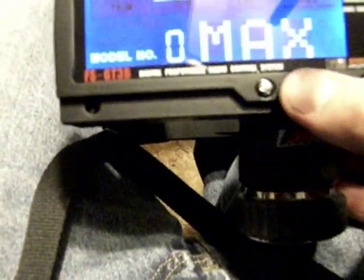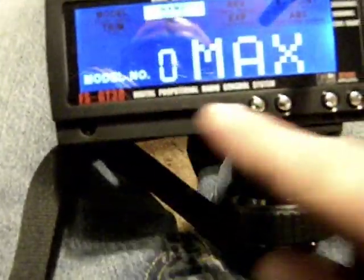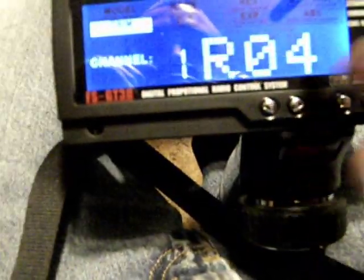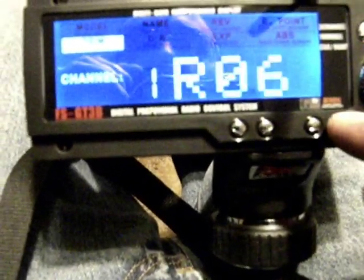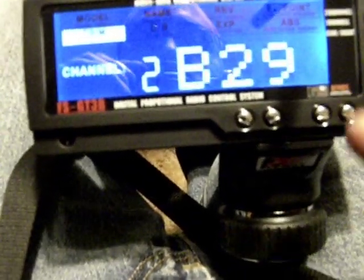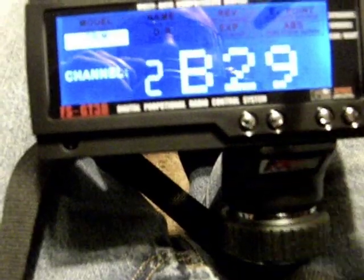Let's say you're driving around and you start messing with your steering trim. Without looking at any of this, you just push your steering trim button and it automatically switches to steering trim. You can either use your buttons like a traditional remote or use the dial to change the steering trim. If you want to change your throttle trim, right there is your throttle trim. Then you just push this in and it goes back to not being adjusted.